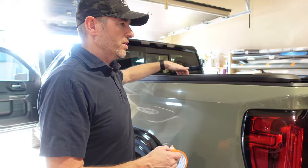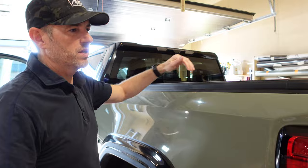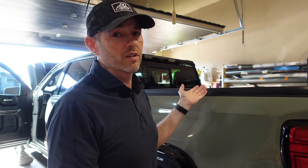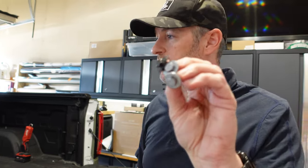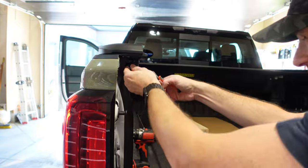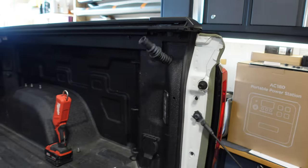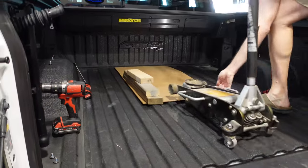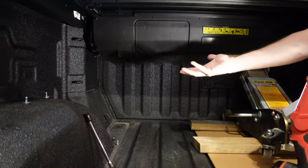Since I'm backing off a number of bolts here, these rails are going to have the potential to shift a little bit when it gets lifted up. So I'm just going to take some masking tape and mark some areas where the weather stripping comes to an edge, so I can have those lined up and re-torque it all down when I'm done — then everything should be exactly where it was. I've removed 14 of these bolts off of the rails. I'm going to have to cut my cable tie because these drains will be in the way. I'll put my floor jack into the box of the truck to lift up the canister, and I'll pull the drains where they're attached to the body so the canister isn't connected to anything we could wreck.